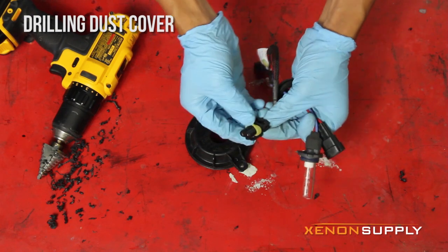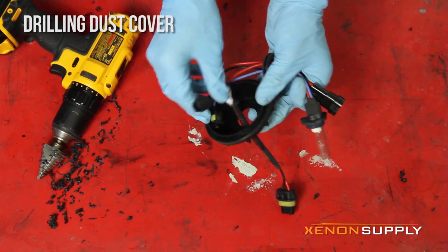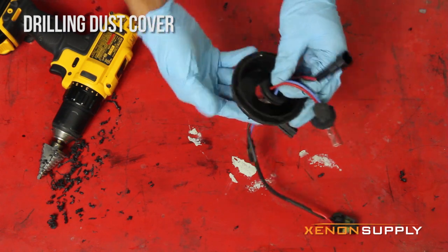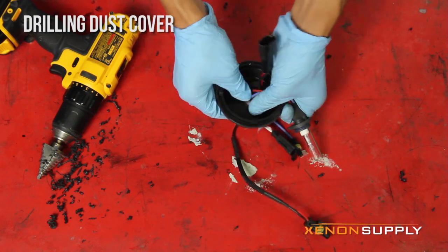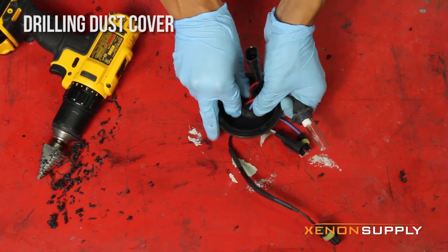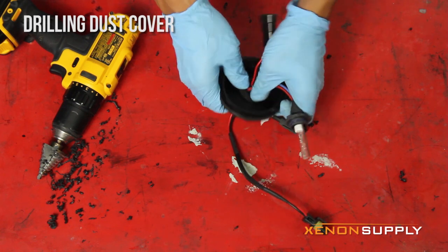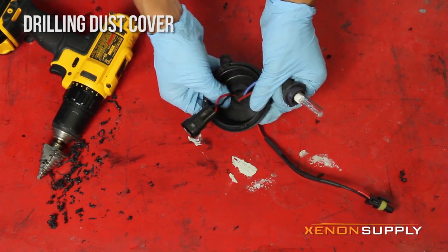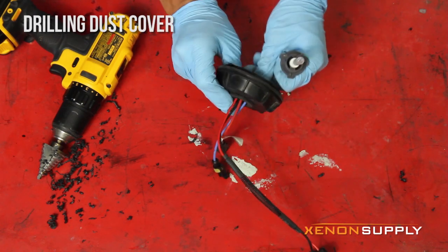You just want to make sure that this male oval plug fits through the hole — that's the biggest plug, and then all the other ones will fit through just fine. I'm going to start feeding it in from the inside of the dust cover, because this is the side that the bulb will be on. Just fit the grooves into this hole to create a nice seal. There we go — you can see I have a good seal on both sides and we can easily pull and tug the wires back and forth.